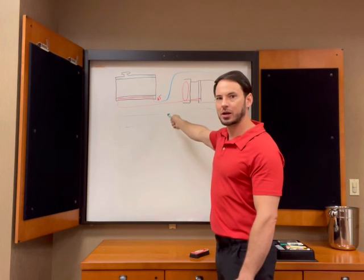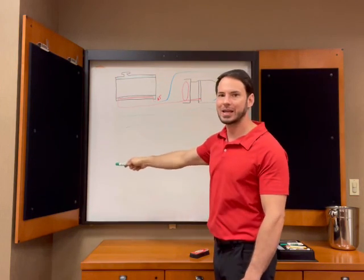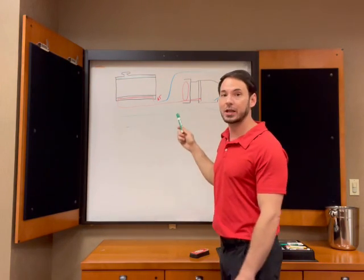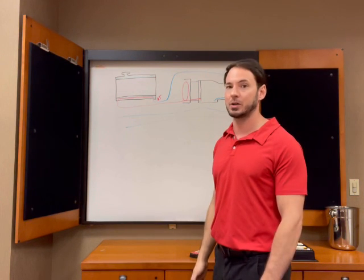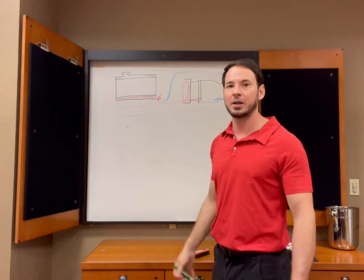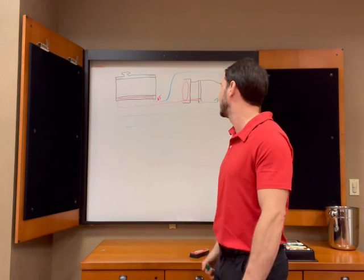I don't care if this fluid is 212 or 190 or 180 or 215 or 220, which again, like I said, you will never get the fluid to 220 in the pan for more than a couple of seconds. And even if you do that, you're going to be doing something wild. You're going to be climbing a hill at 35 miles an hour in manual second, towing a trailer. It's really difficult to get these that hot. You just can't do it.